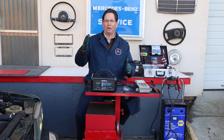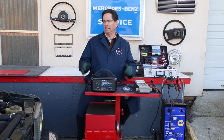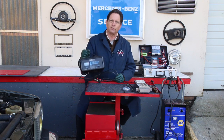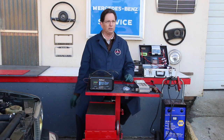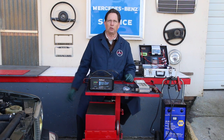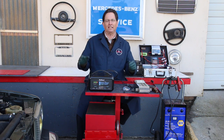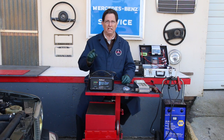You try to figure out how to charge the batteries. If you overcharge a battery, you're going to damage it. And then you forget to turn the battery charger off. This is a typical battery charger — I've been using battery chargers like this for 40 years. You plug it in, hook it up, set it to 2 amps or 10 amps, and walk away. It's supposed to shut off automatically, but half of them don't. They go into a cycling charge, clicking on and off. I'll never forget the time one of my employees hooked this up to one of my batteries, and I came back into the shop the next day and heard a gurgling noise — the battery was boiling in the car. That is really dangerous.